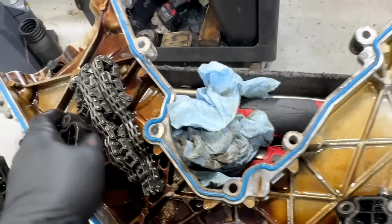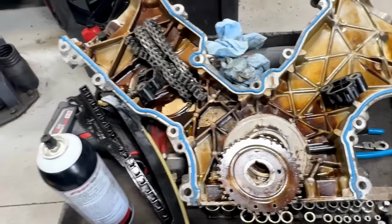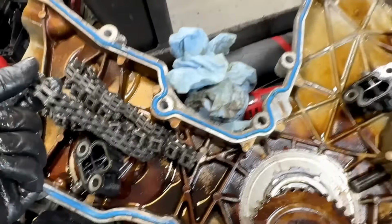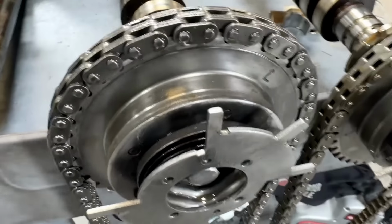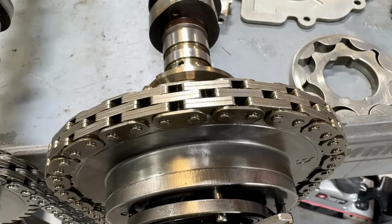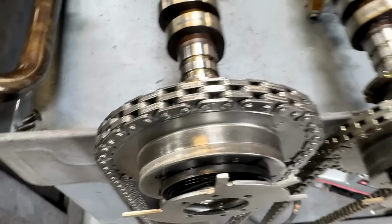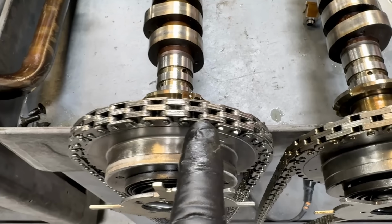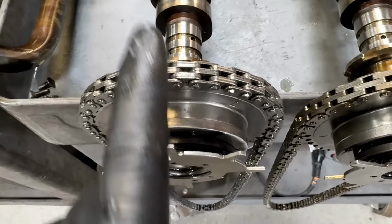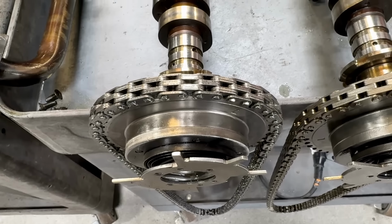You see a difference? Now, the other thing I want to talk about, because I'm trying to give a lot of information to you guys, is these aftermarket timing chains. These timing chains with this weirdo profile. See that? That is so weird to me. I hate seeing those. That's Ford. That's aftermarket. These chains, I don't know who makes them for Cloyes and Melling, but recently, at least the last 2 years, these have been known to break a lot. That's bad because it's an interference engine.